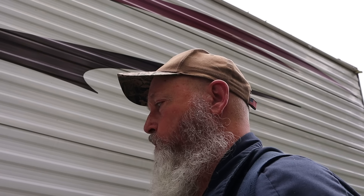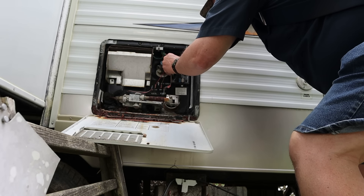Once I got the converter changed, I cut the water heater back on, but that relay back there is still chattering — going on and off. I'm going to plug the old board back in and see if we have any action on that relay, because the relay might be bad or we could have a bad wire — there's a lot of mouse signs in this thing. I may have to chase that yellow wire from the board to the relay, since that's the wire that energizes it on 12 volt. The old board could be bad too — we've seen multiple failures before.